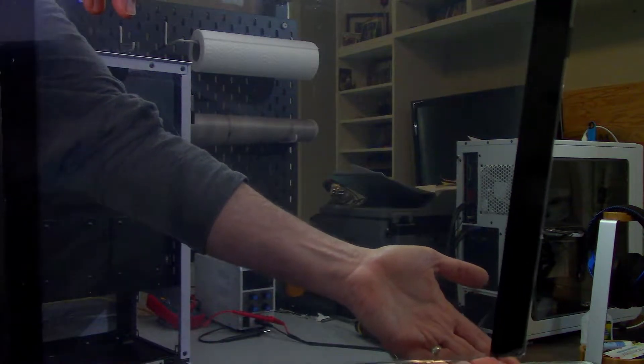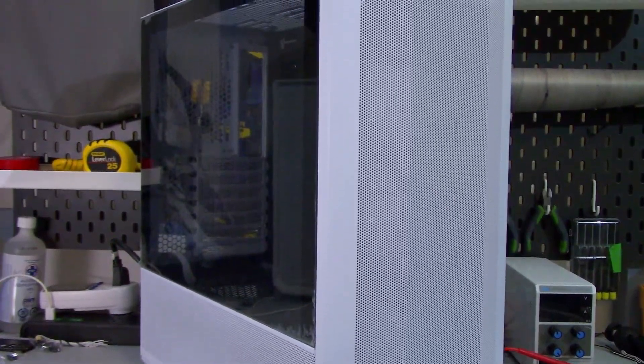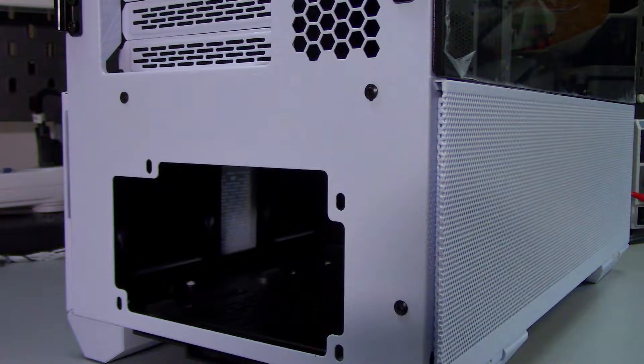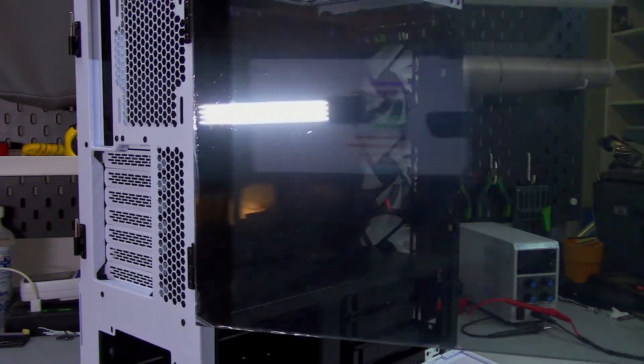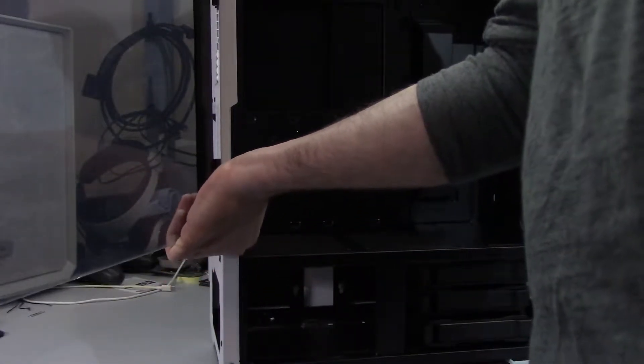The glass panel is not fully clear — it does have a slight tint to it. The left side panels are very similar. To remove the glass panel on the left side, open the lower steel mesh panel using a small groove located at the rear of the case, then pull the top of the panel away from the chassis. Swing the glass panel open more than 90 degrees, then slide it up and lift it away. Again, make sure to have some weight on or in the case, as tipping is possible — so just be careful.